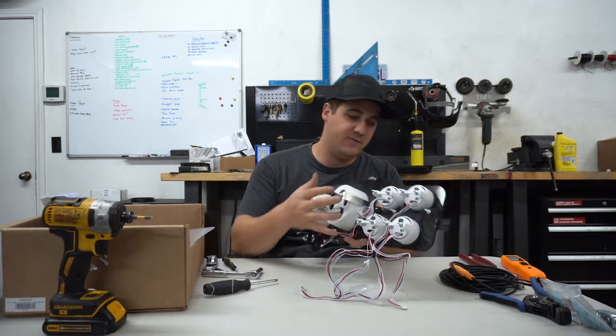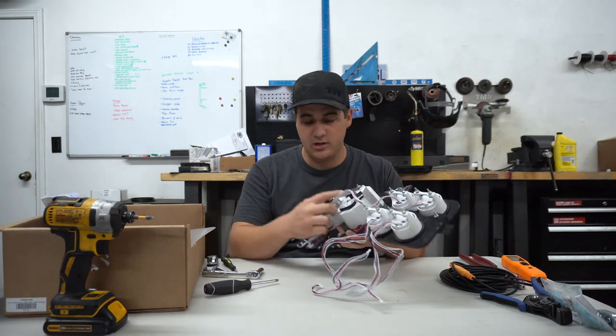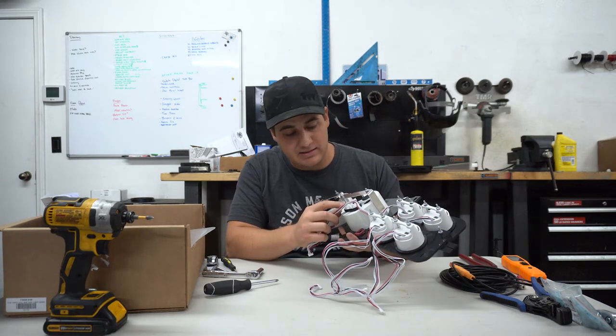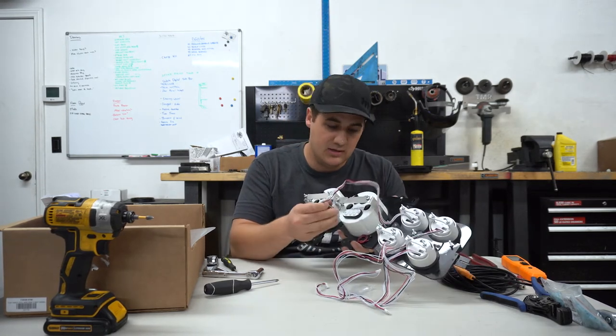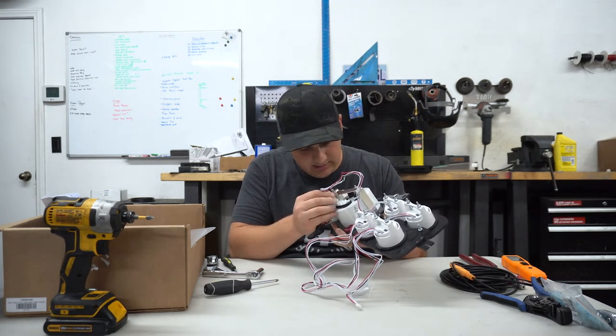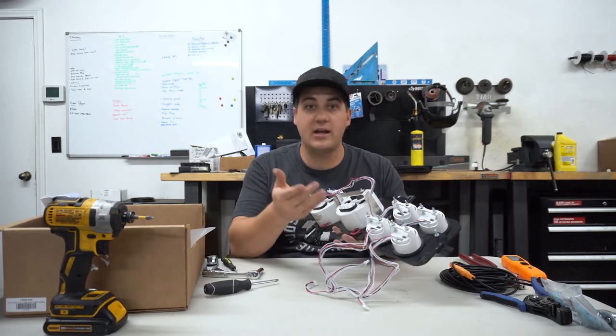Let's wire the smaller gauges in — they just plug in here to the back. Our fuel gauge wiring is going to go to our speedo wiring and it is going to plug into slot letter B. We have labels B, C, and D on the gauges. This is going to slip into slot letter B and clip in. That's all you got to do for the fuel gauge — done. Next we'll work on temperature. Our water temp is our bottom left here and it is going to go into slot number C. Then D is not used, so don't worry about it.